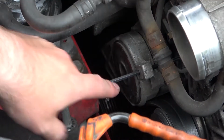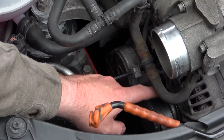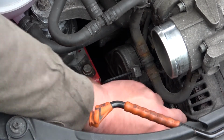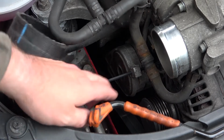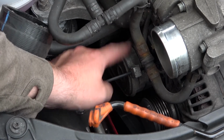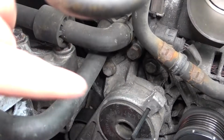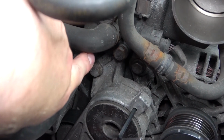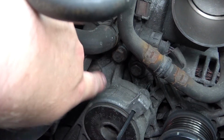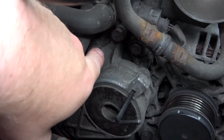So now that is locked, and the belt, which is just over here, is now loose from the alternator, so I can just pop that down there for a minute, get that out of the way. Where this is coming off anyway, I'm going to take that off first and then take the alternator off. Now there's 1, 2, and just behind this important pipe just up here, there's 3 13mm bolts to get this tensioner off. You need to get them off.